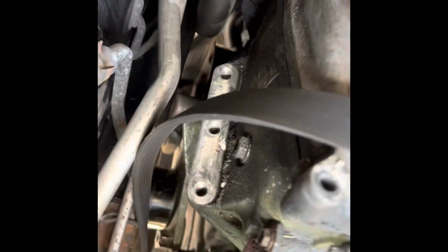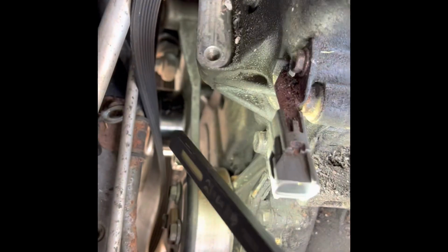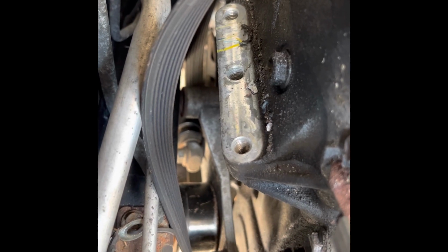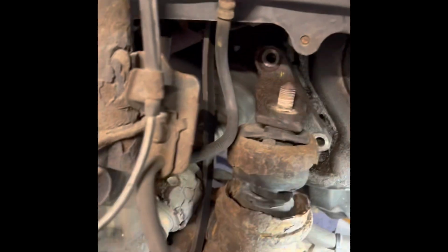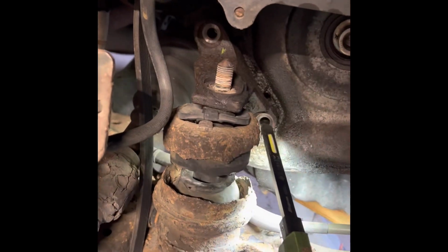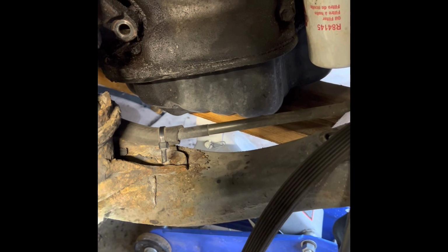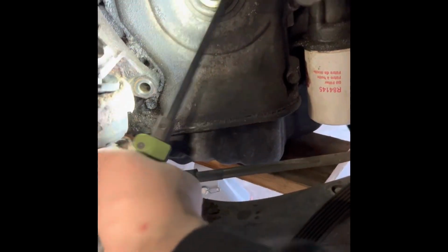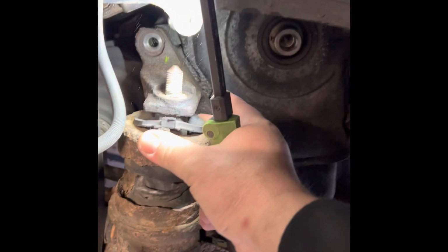Okay. We got the tensioner off, but when it comes down to either jacking up the engine or letting it down, it won't come out. That mounting bolt won't come out until we do one or the other. So looks like on to the next thing. Down here I got this mount loose. This is a 19. These are 14s. There's 3 of them. There's one back here I haven't gotten yet, but the ones on the bottom of this mount are 17. There's 3 of them. One here, obviously one here, and then one towards the back. And it's ready to come out. It was broken, but I'm gonna see which comes first. Get that mount out or get this guy out.